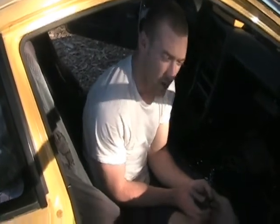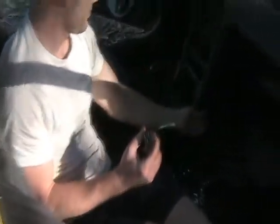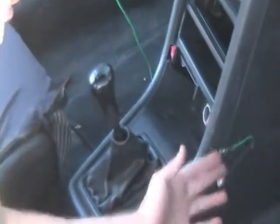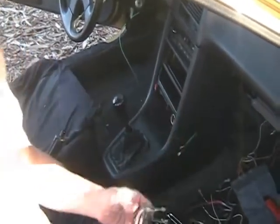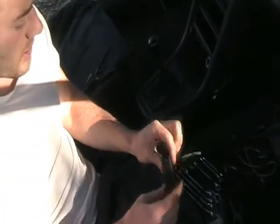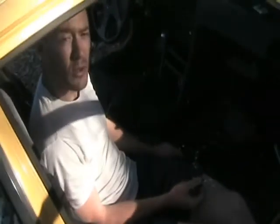Alright, we're at the final steps here. Here's the outlet that's extended from the other inverter — it's going to plug onto these two. I've differentiated these such that there's no way I can screw it up. Once I plug that in, I'll wrap them up with tape and then shove this back in there. I designed this outlet such that these two tabs catch on the plastic and it won't be coming out. I'll plug it up there, wrap it with electrical tape, zip tie that off, and I'll have two inverters in my car.